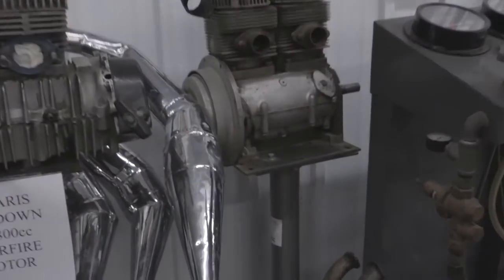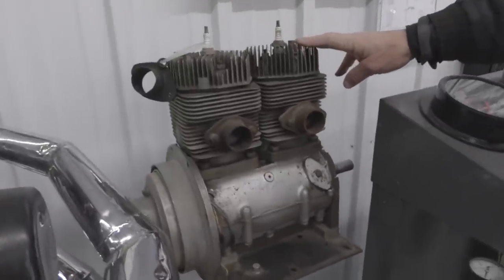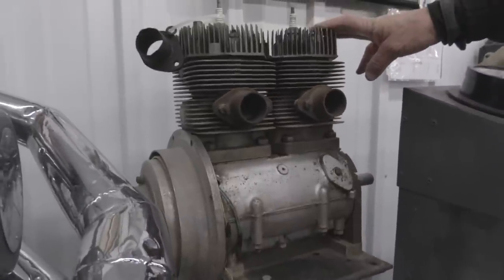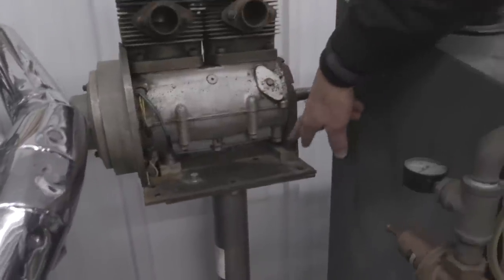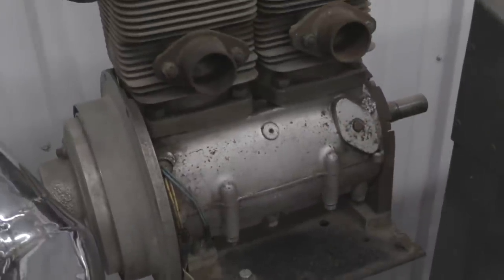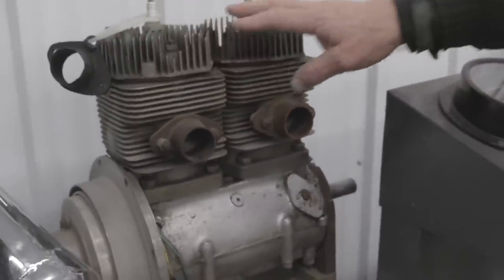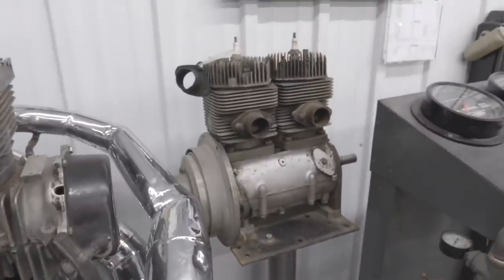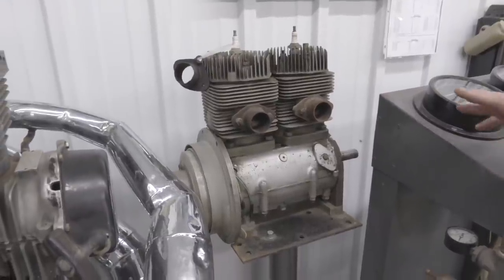This is another motor, like I showed in that one race sled. Very lucky to have this part of history. And this was the first twin cylinders that Polaris had. It's a JLO. And the crankcase, they had to build this piece out here to mount it in back in here, but this is a mounting area. And this was a 384cc motor, and then they built it so that it was a 744 with different 372 cylinders added. So it was trying to get horsepower back then and using every possibility.